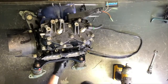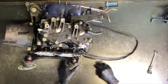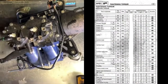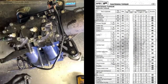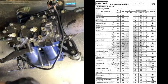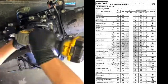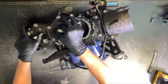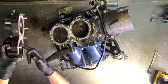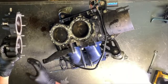Now we're going to dig into our top end — this is the most common part of the motor you'll tear into. You don't have to remove the carburetors to dig into the top end, but I wanted to do that so you could see better. I'm going to spin this motor around. We've got 12 millimeter head bolts all the way around — two, four, six, eight, ten head bolts in a numbered pattern, because you do want to install these and torque them down in the correct pattern. I'll have those torque specs in the description below.